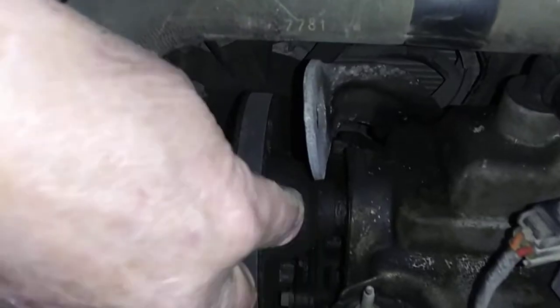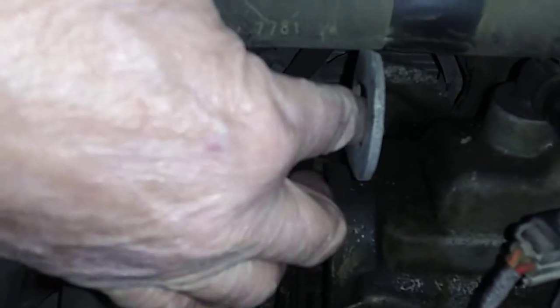This has to be loosened from underneath the car, that's why it has to be done first. When it's up here, it's blocking the valve cover — you can't get the valve cover up past this. There's a big bolt, 18mm, on the side of the engine. You just loosen that and this flops over out of the way.